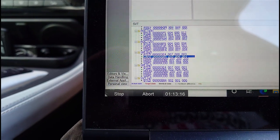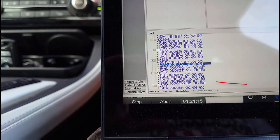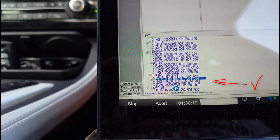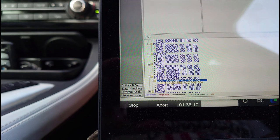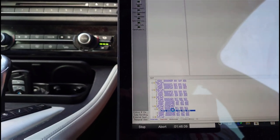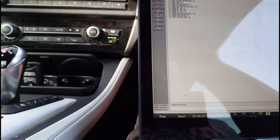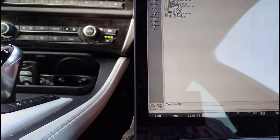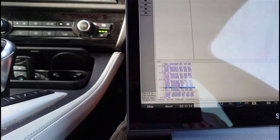Check this - down here SM6D I believe is the driver's seat, SM6E is the passenger seat. I think what I need to do is code this module to the car and then jump into ISTA. I'll open this up, edit the FDL. I need to code this module to the car. There's the Z module. Click on it and say Code.